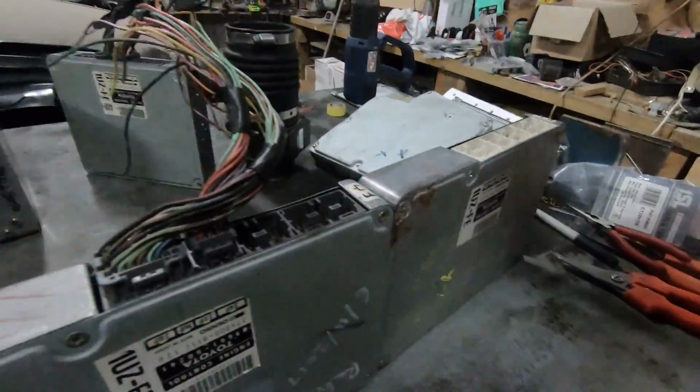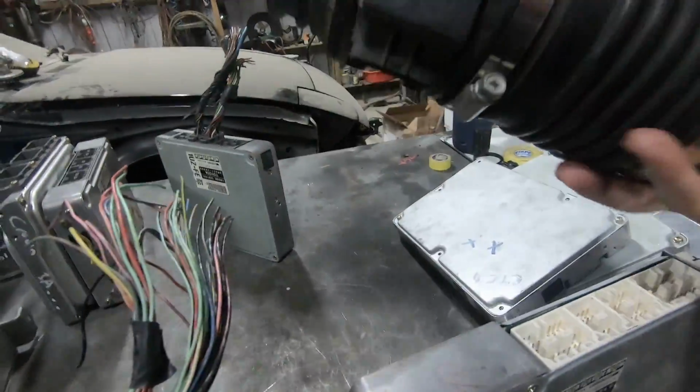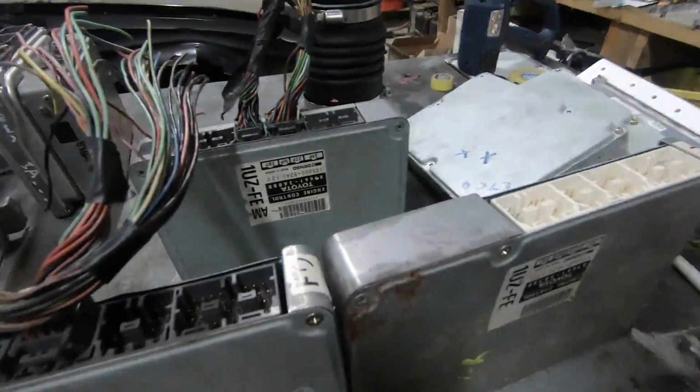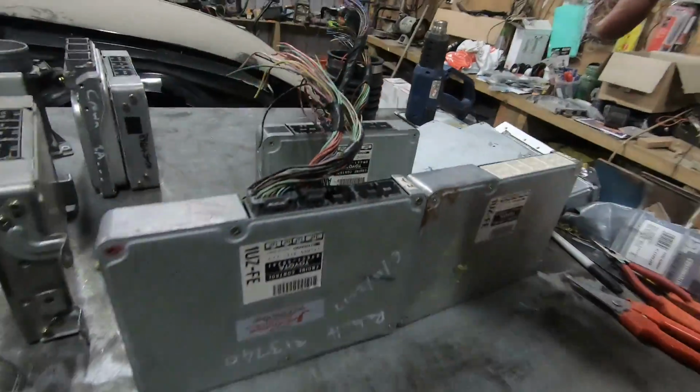So this one here and these ones, sequential injection. So sequential injection, 8 injector drives. They run the hot wire airflow meter, that one. It's all one piece. This one is the same, sequential. Transmission interchanges between these ones. But very similar. And the looms are actually really, really close. But they just changed a few of the peripheral wires around just to annoy me, really. Keep me on my toes.